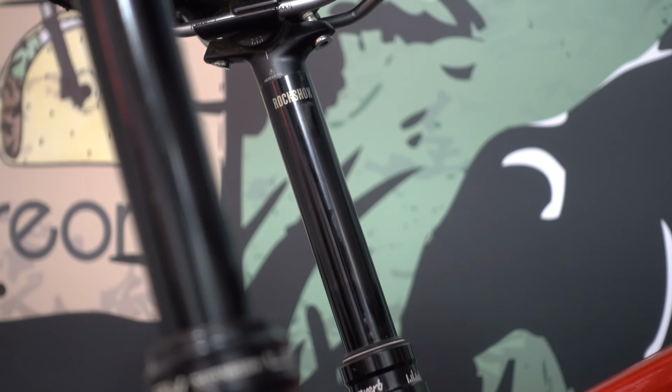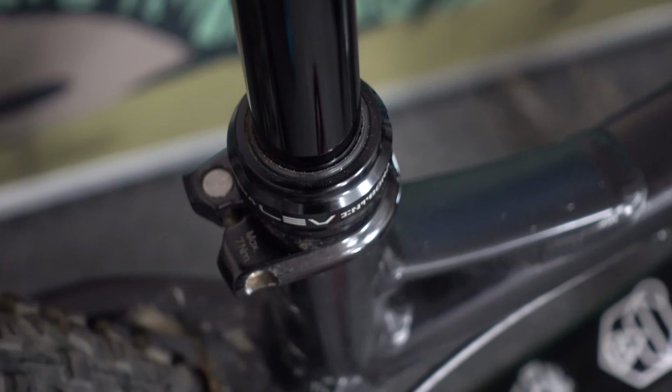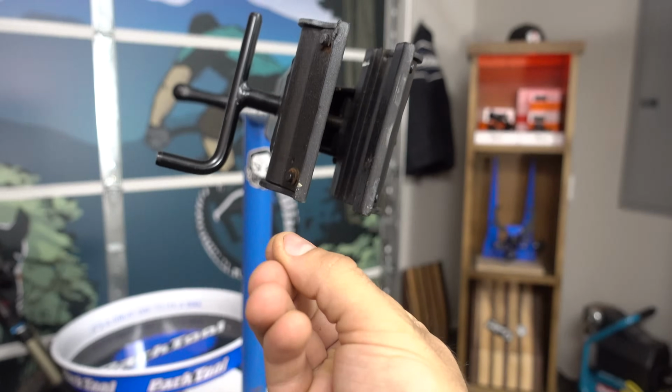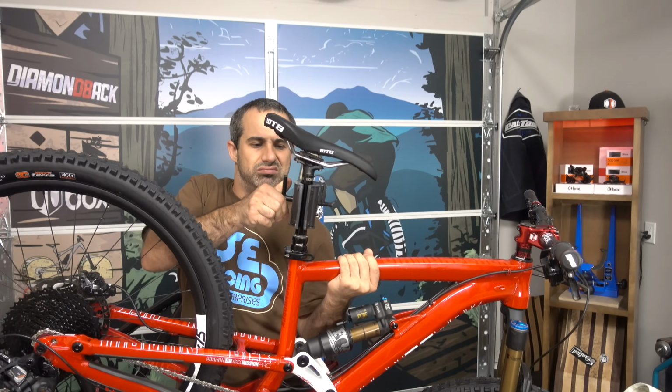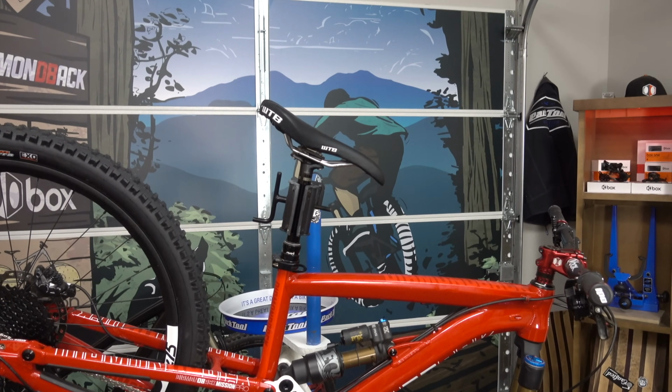First of all, you should avoid scratching the stanchion of your dropper post. Scratches can cause abrasion on the seals, which only worsen with use. If your stand's clamp is covered in dirt from another bike, you could be forcing sand and rocks directly into the surface of your post, causing abrasions. This could potentially ruin your post.